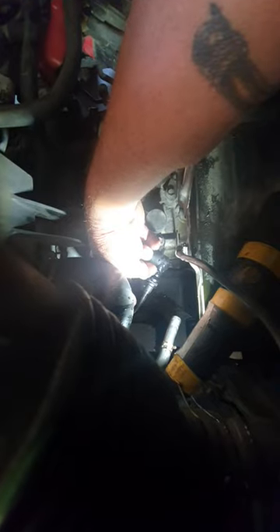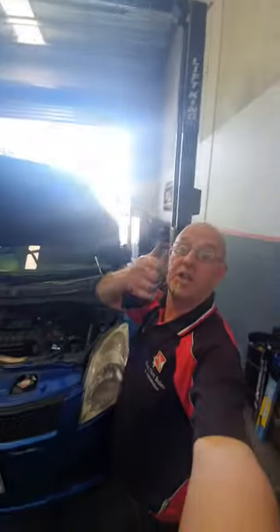What you need to do is push the spring clip down, pull the main plastic line out a little wee bit, and then it'll enable you to actually bleed it. You'll see everything gravity bleed, and someone will push their foot up and down on the clutch and it'll come out like a waterfall. Simply push the fitting back in, and when it clicks again, it's done — thumbs up.